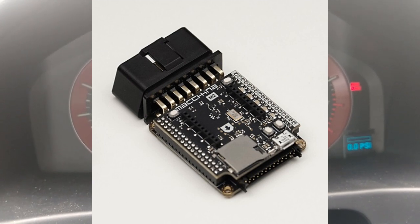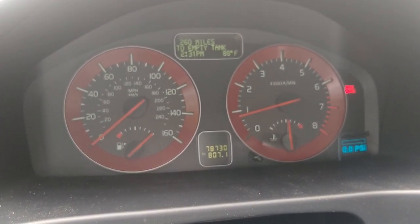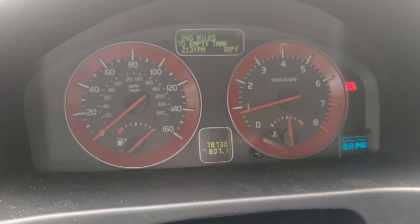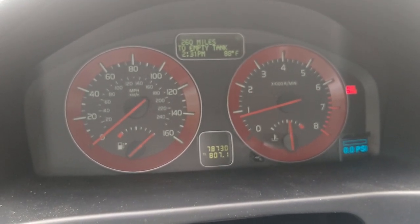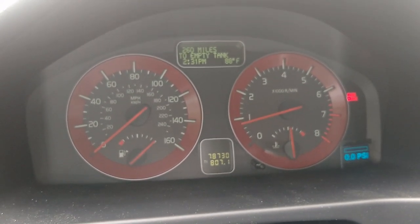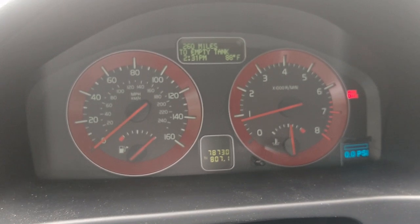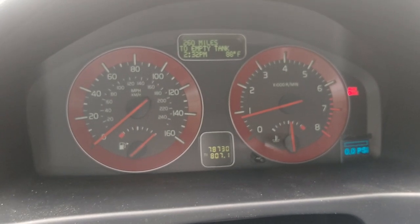It can be a little difficult to get this thing working if you don't know how to do port manipulation on the Arduino processor. The rest of the project is comparatively simple — it's basically just sending messages on the CAN bus, waiting for the reply from the ECU, and figuring out how that data is formatted in the CAN frame. Volvo, for some unknown reason, uses extended IDs for their CAN bus, both high and low speed.